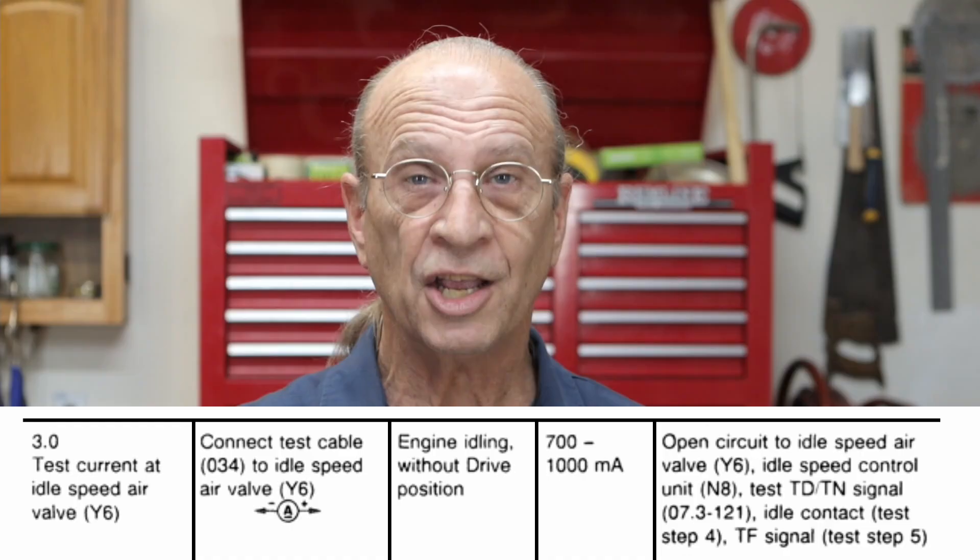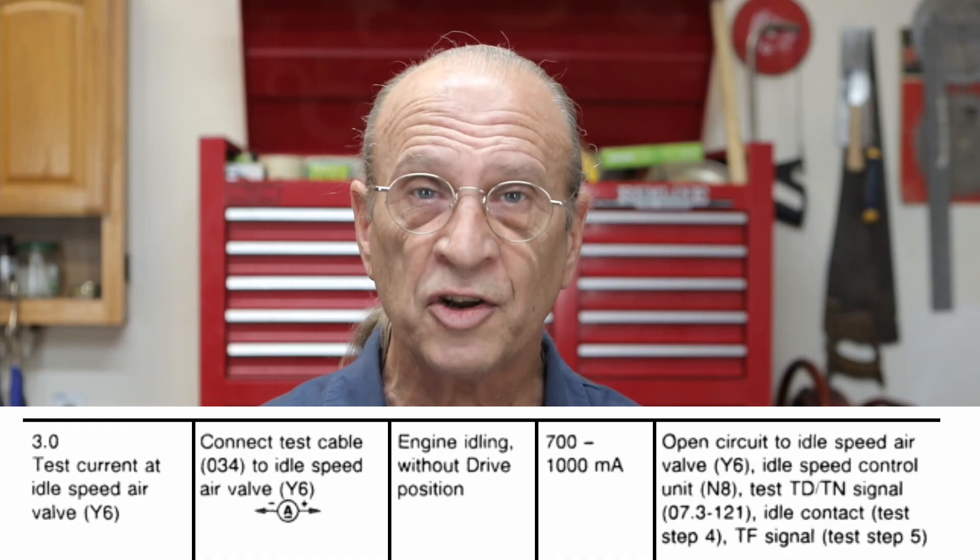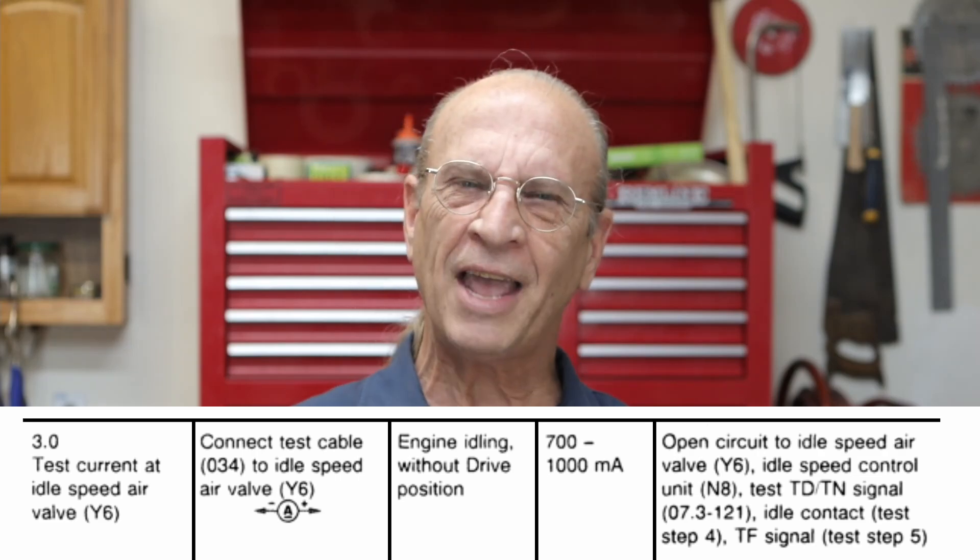What I did off camera is grabbed the other unit I had in a box. It's old, not original to the vehicle, it's a different one. I put that in and it worked the exact same way functionally, but I did not have an amp meter to test it. So I thought I'm just going to go ahead and end it right here — it's been long enough, maybe there's more to come. What should happen is that when the engine is idling, you should get an amp draw of between 700 milliamps and one amp — that's what the manual tells you. The idle's down, everything's ready to go. We're almost ready to start fiddling around with the duty cycle, but I'm not going to do that until I solve this issue with the amperage draw.